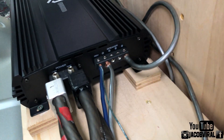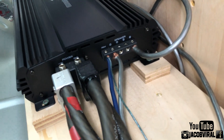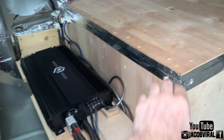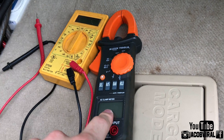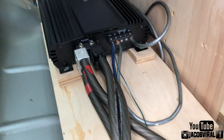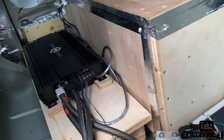Hi, this is Jacob Vile. Today I want to find out how my impedance rise changes around my peak — where I peak at. I'm peaking around between 42 and 44 hertz on my single 10-inch box build. I'm going to use my device with my multimeter as well as my Klein's tool clamp meter to find out what my amps and voltage output are, then divide the numbers to find out what my rise is for the frequency where I peak.